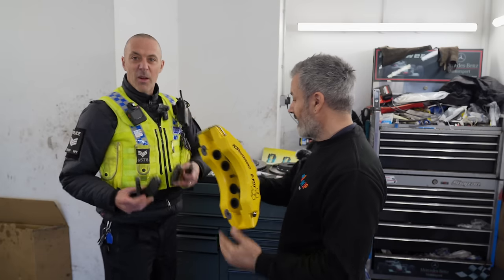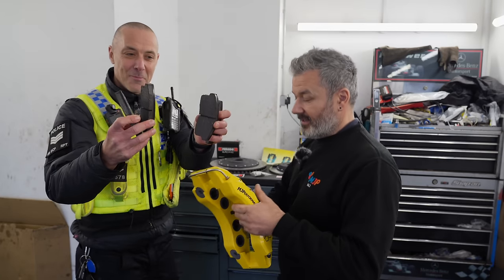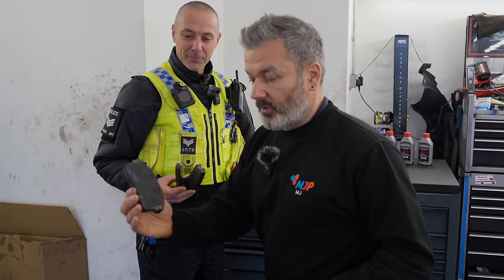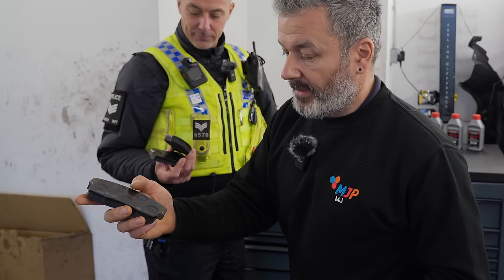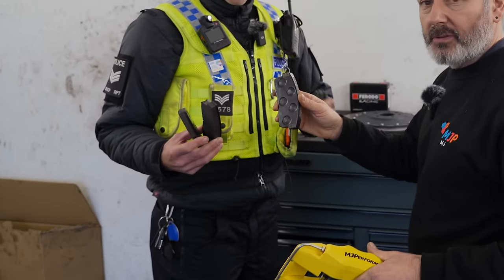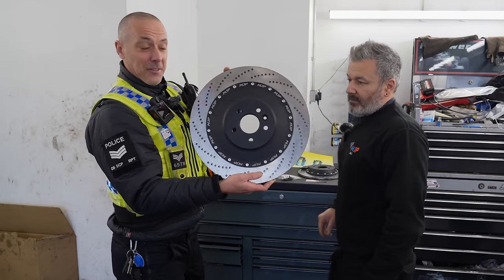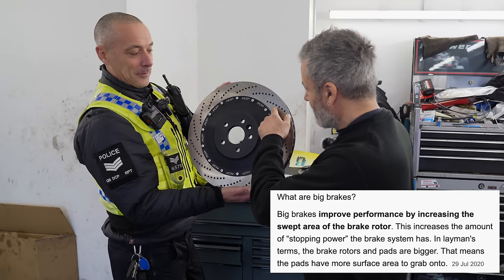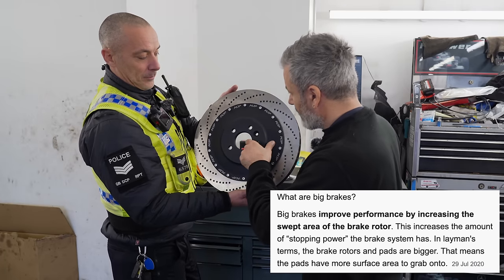It's very impressive. But it takes four pads. Yes. Yeah, it takes four Brembo pads. And interestingly, if you look, they're all embossed with different numbers, M3, B3. They have to be put in a certain position. And it goes on that. Yeah. So that's your 400mm disc, 3/4 cross drilled, center bell, all engraved.